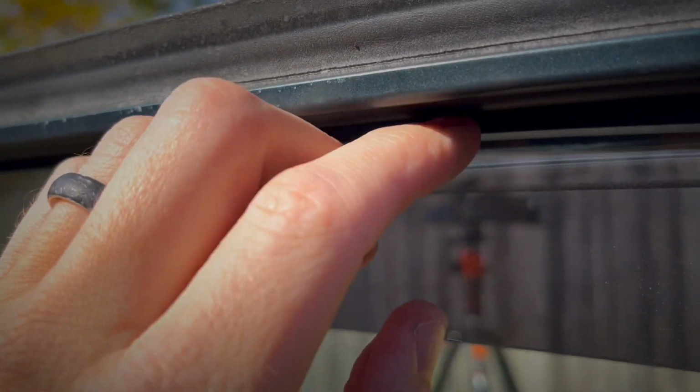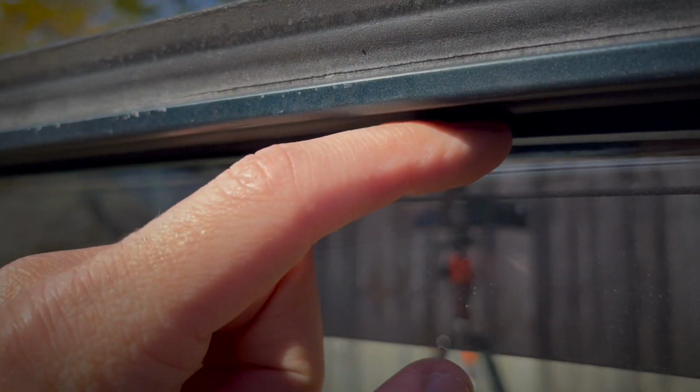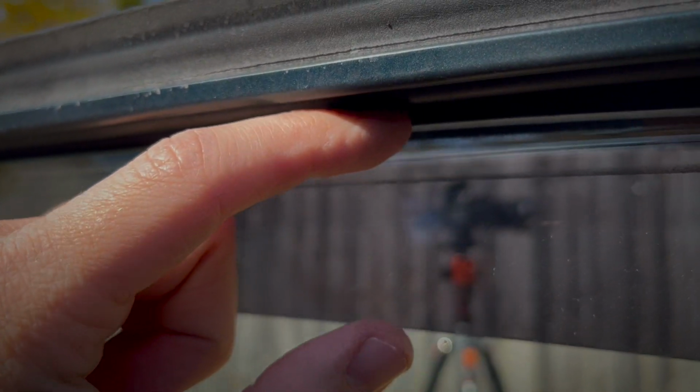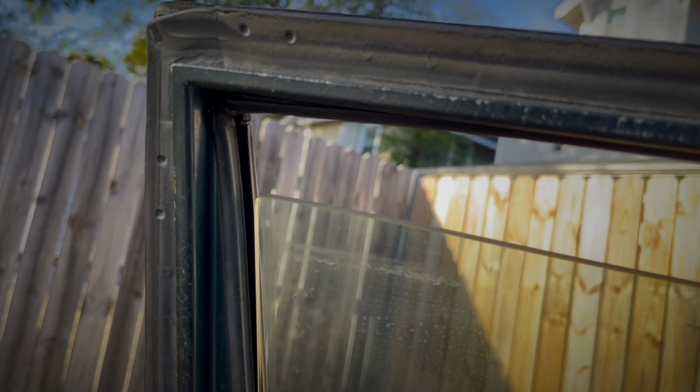But now we're going to talk about the negative side of this kind of vent window visor. It goes inside the groove of your window channel. And while that doesn't sound terribly problematic right now, it is when you go to drive it. When you have this type of vent window installation, you can't roll your window all the way up in the channel afterwards, at least not usually. Most manufacturers don't leave that much play in the window groove to allow this piece of plastic and the glass to slide up in there. You can force it, by God, you can get that sumbitch in there. But on our Volvo, it's just not gonna happen without something breaking.